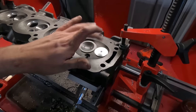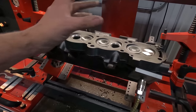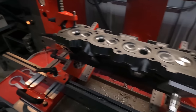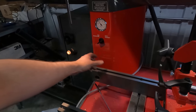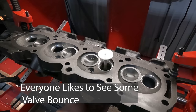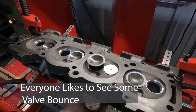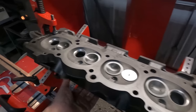Testing an exhaust valve — I've only got one of the new valves in; we're still waiting on the rest. I reground the intakes because we're planning on reusing them, but the exhaust valves had some wear so we're replacing those. Again, that's with no lube on the guide, and I'm confident that the seat and valve are cut correctly. That one's got the lube on it.